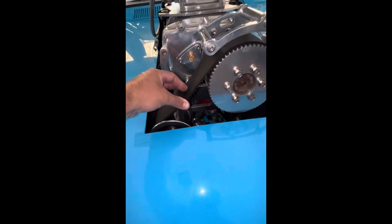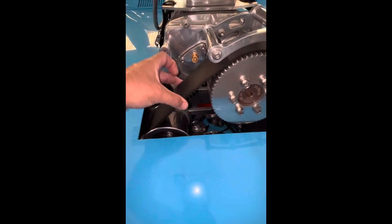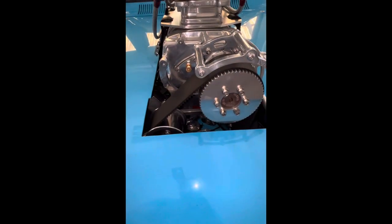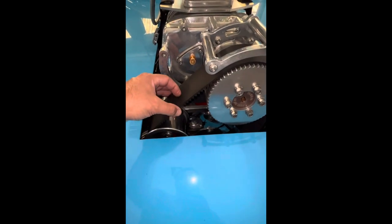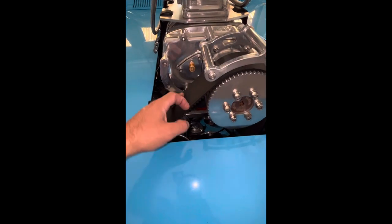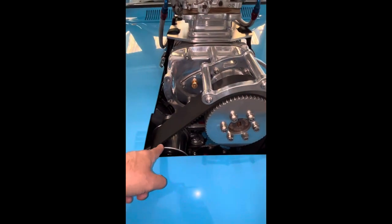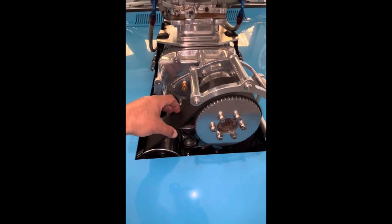When you set up blower belts, when it's cold you always leave them a little loose — they have to have adequate play. Your cog's not going to let that slip. As everything warms up and the belt puts a bit of heat in, it starts to stiffen and tighten up. So first installation: cold belt needs to have slack. Never install these things cold and real tight, because then you're going to put load on all your bearings, even your crank — that's kind of a bearing as well.